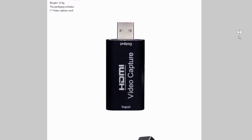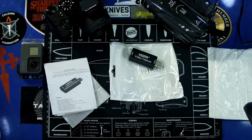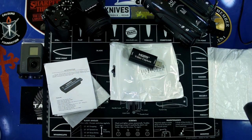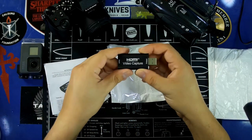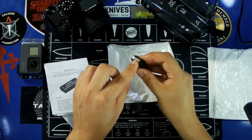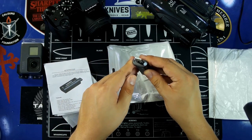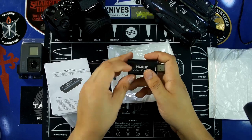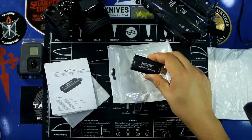The purpose of this video is to show if it works with cameras. I am not a gamer, so I cannot test it with game consoles. On the front side of this device we have a USB port, and it is not blue, which signifies this is likely a USB 2.0 connection. I'll still plug it into a USB 3.0 port to see if that helps. On the other side there is the HDMI input, and there are no other ports on the device. In theory, we should be getting audio and video through this to your PC where you can capture or stream it.